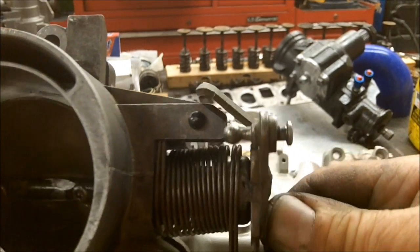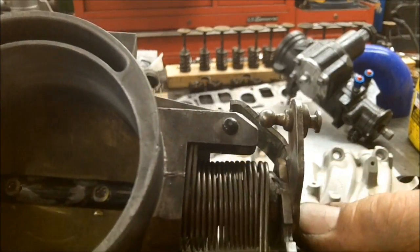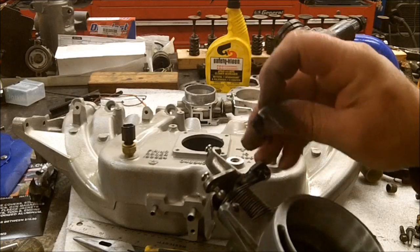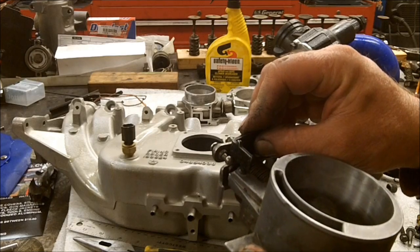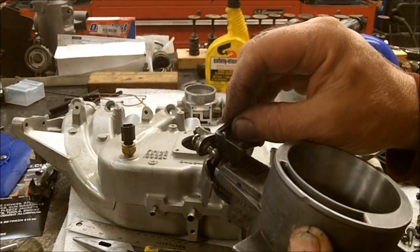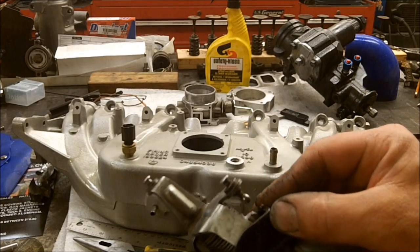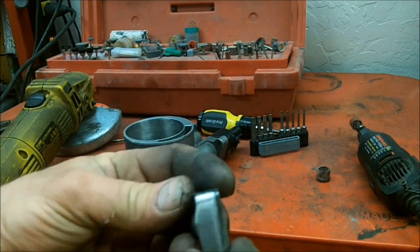If you watch carefully, you got that hole right there — it goes in the hole like that. Get the butterfly reinstalled. The spring goes in there. We utilized this throttle hookup that was on the Durango as a place, took the spring, and that looks factory. Now right here is where we're going to be hooking up our Jeep throttle. You can see there's probably a little clearance issue there, so we're just going to notch this down right in this area right there. This piece right here is going to be our new throttle stop.